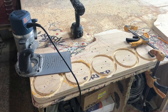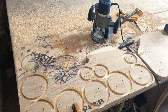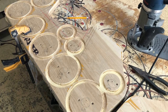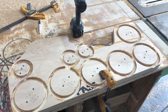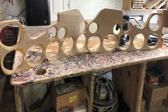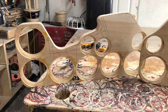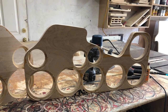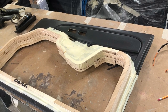Now we're cutting out these baffles using the circle jig and my Bosch router. I'm cutting out the flush mounts first — this isn't a full through flush mount, which is why I have these layers screwed together; I don't glue until the very final step once I have the holes all the way through. I only did about a half-inch recess because I wanted enough meat in the wood so when I put the speakers in and screw them down, those screws will actually have enough to bite onto — otherwise in a high-bass vehicle like this, the speakers will eventually fall out or shake loose.